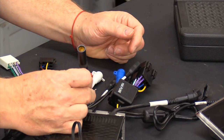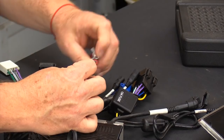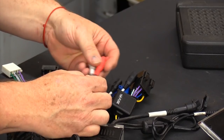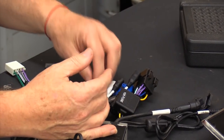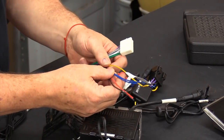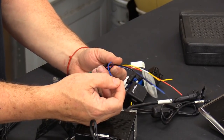Obviously it has a radio aerial input. Then you have your plug for the external mic, which I just showed you. It has line outs to allow you to hook up through a preamp using RCA jacks, going out to an amplifier for front and rear amplification of the system. It comes with all the connections to hook up your speakers and power your unit. All the wiring is here — you have everything you need to hook up for your constant 12, your switched 12, your ground, and this is the power wire that goes from the radio out to your subwoofer or amp.